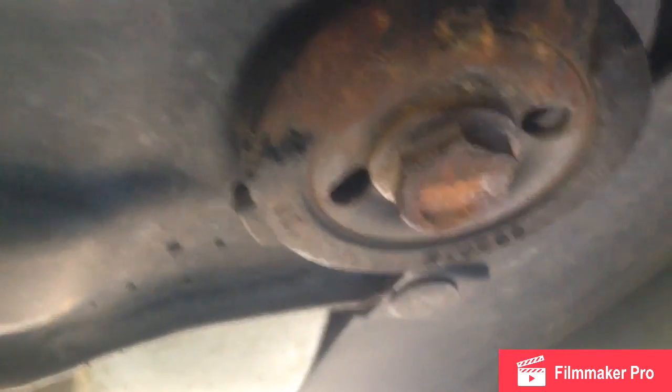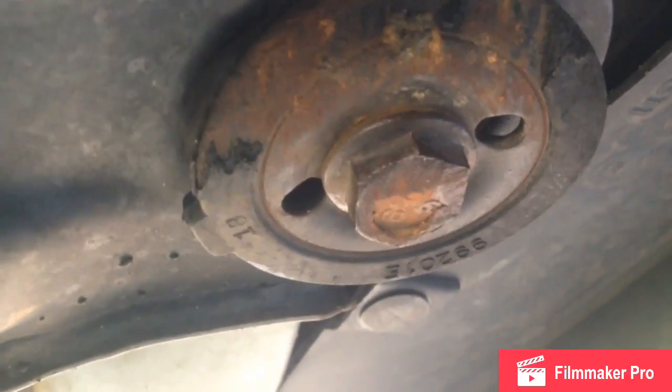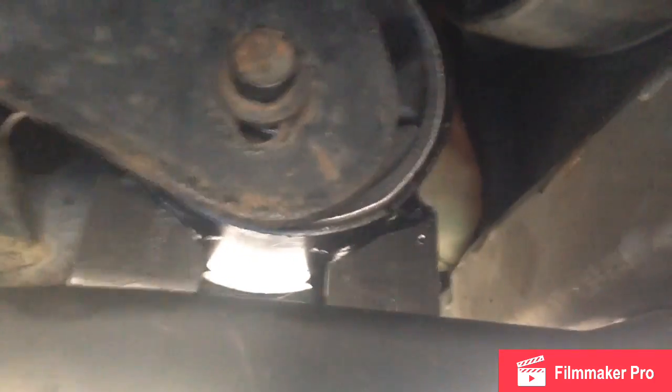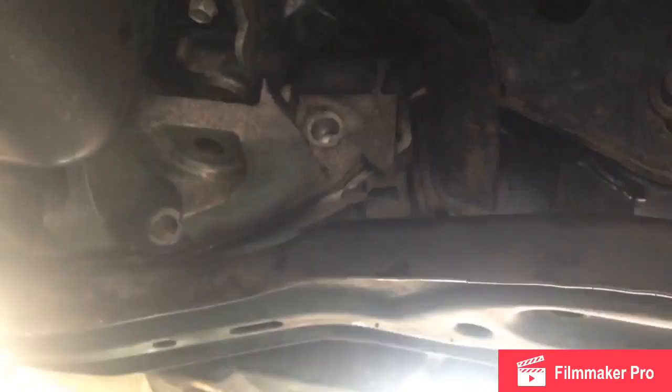This bracket just has four bolts, two for the mount, and then this bolt which is pretty chewed up on mine - hopefully I can get a socket on it without too much hassle. This front lower engine mount has a locator tab that goes down into the crossbar, so taking this bolt loose will help you pull this huge bar out of the way.